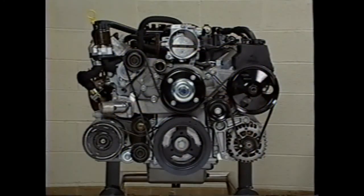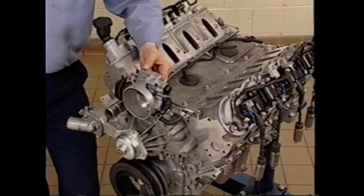And lastly, we'll look at the engine's cooling system. Coolant follows the conventional flow path, passing through the block first, then the cylinder heads, and finally through the outlet to the radiator. Positioning the thermostat on the inlet side helps eliminate thermocycling. A coolant vapor port located at each corner of the cylinder heads eliminates vapor pockets for enhanced cooling efficiency.